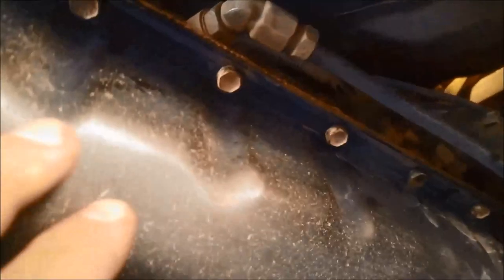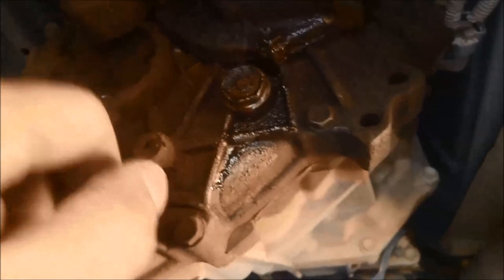Got the pan back on. Just be very careful you don't misalign the holes on the gaskets — very easy to do. And while you're under there, have a quick check: check your unis, check your front and rear diff. This one's got a bit of a leak there on the transfer case.